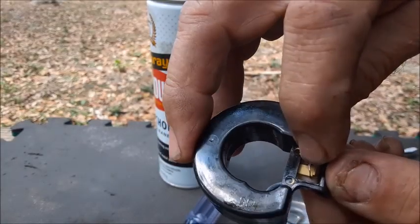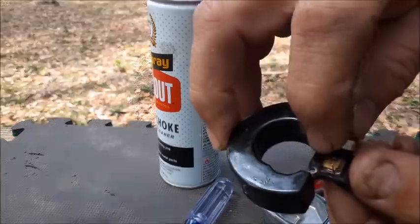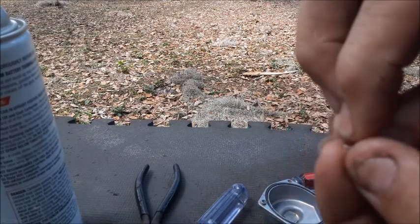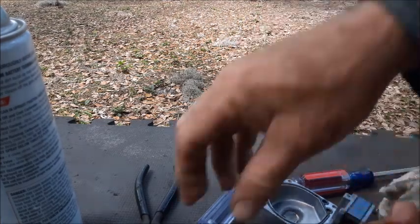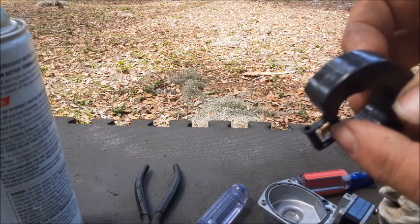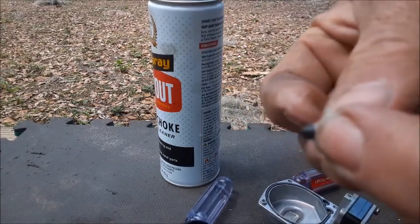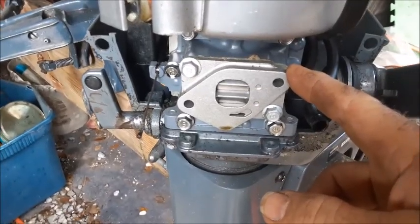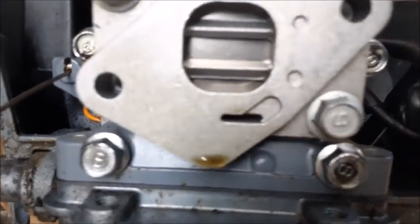In this particular situation, the little metal strap that's supposed to pull the needle valve back down when the float goes down was not adjusted properly. You can see I actually bent those two little metal tabs down just a little bit so it's going to start pulling that needle valve down sooner as the float drops. You do not want to bend this copper tab right here because this is actually a gas level adjustment of how high the gas will go in the carburetor bowl. You also want to inspect your needle valve to make sure there are no grooves, pits, or anything on the tip of it. This plate right here stays on the motor — it's not necessary to take this off to get the carburetor off, and these two bolts do not have to be messed with. You also want to take a look inside there at the reed valves — see if anything is rusty or looks like it had damage, because that's essential for the carburetor to work properly.